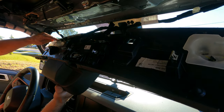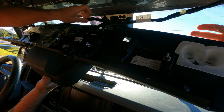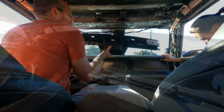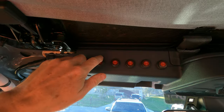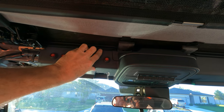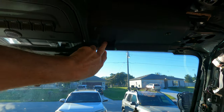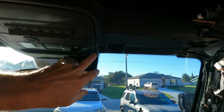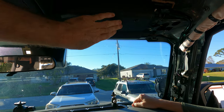Right now you have these little clips. You have this one that slides on here and one that slides on here. There's a seal right here that when you put this up, if it's not correct, it'll actually end up underneath it — you don't want that, you want it up. This right here is not all the way up; it needs to go a little bit further. I believe the sun visor will actually pull this all the way up where it needs to be.